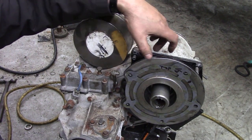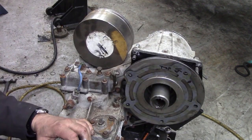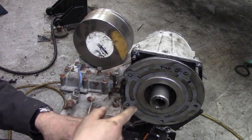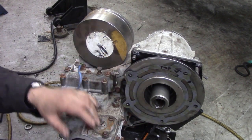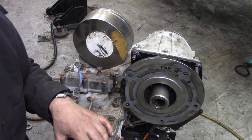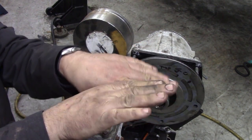The crucial measurements are: this was 60 millimeters wide, and I had a bit of a struggle trying to get the orientation right. This is the most important thing — making flanges, lining them up, that's easy. Getting the distance right, Stevie Wonder could do it. The thing is, you need to get the orientation right.